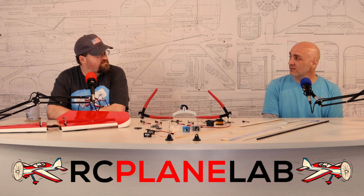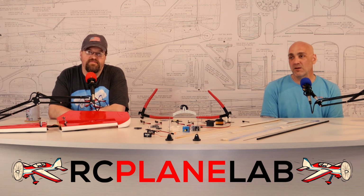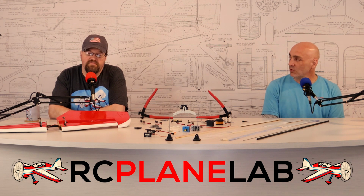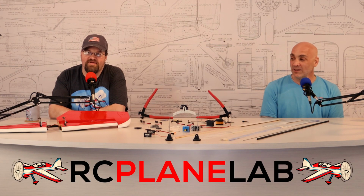Oh, no, I get that. Yeah. It's less hanging out from the back of the airplane. Sure. I like it on the inside because then my clevis is on the outside. So if I need to make an adjustment to the airplane, I don't have to pull the wing off and get into the fuselage to the radio. I could just turn the clevis right there at the surface and make my adjustment. But I totally get the cleanliness. I had not thought of it that way, but yeah, I may set him up like that. I just blew your mind. You did. Because I'm all about cleanliness. I know. That's why I said it.